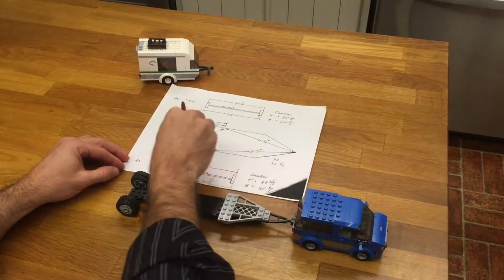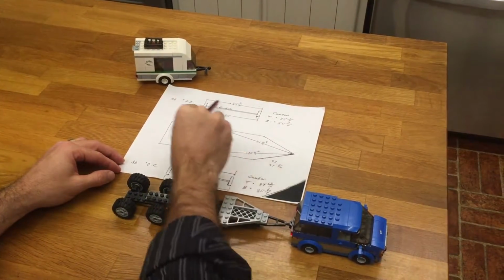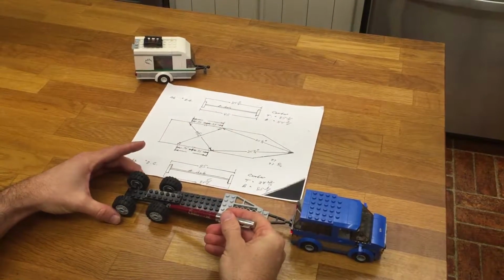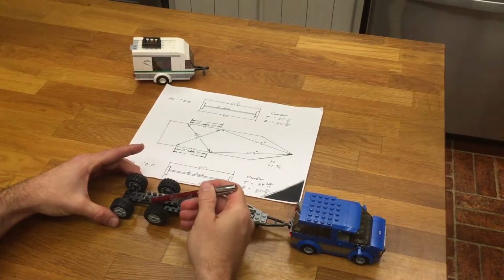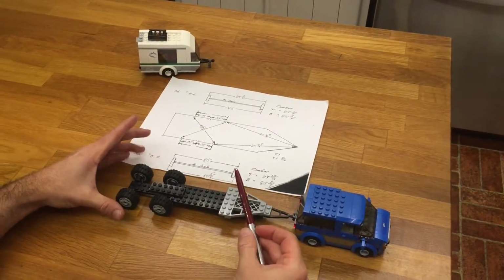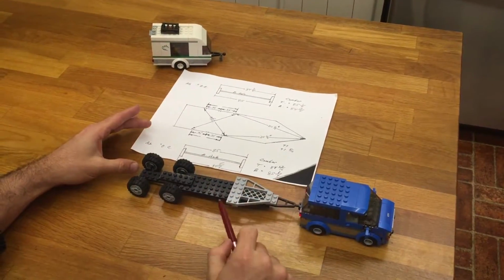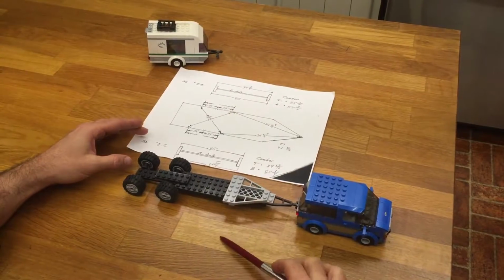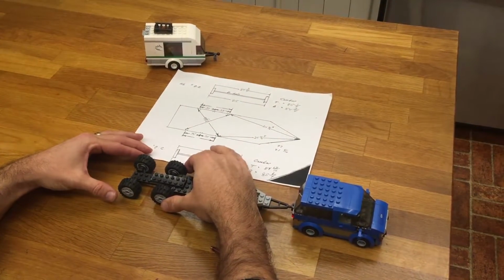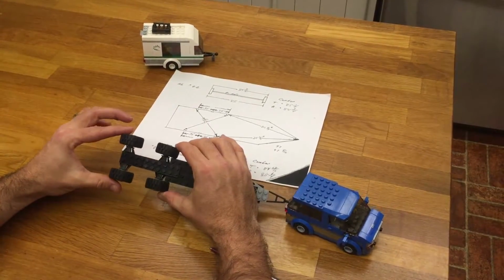The next one is where you look at these outside of center. What we did is here you see the front of axle, this is the front and this is the back of that axle. So that's measuring from here to here, and then the back is measuring from here to here. Those measurements need to be dead on for the axle to track properly as you go down the road. And on the front axle, what's essentially happening is the front of these tires is slightly toed in. And then the back axle, those tires are slightly toed out.